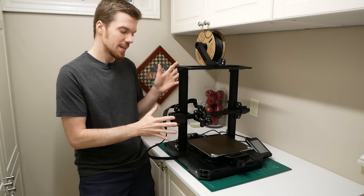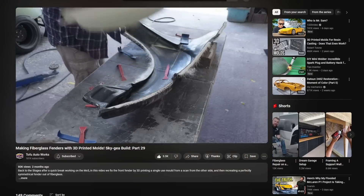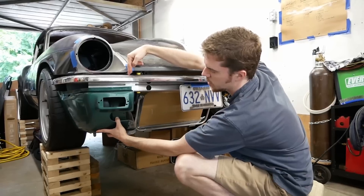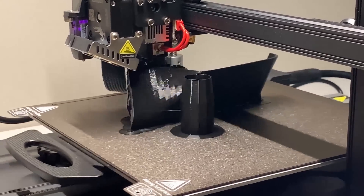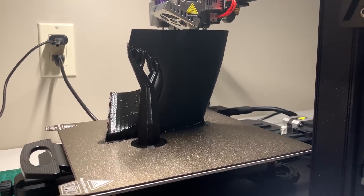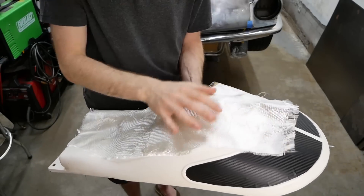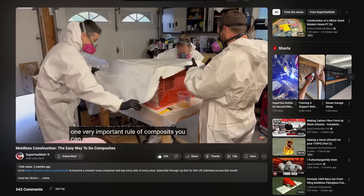To say it's going to make the molds directly is inaccurate. You can do that, and it seems to work well, but unfortunately if we hold a mold up to our car, we'll still have no way of knowing what the final part looks like, as it'll be the inside face that's the finished surface, not the outside. I'd like to see the bumper in person before even touching any fiberglass. What we're going to do instead is print parts that look like the finished product, and when we're happy, we'll simply skin over the face of them to make our fiberglass parts. That does mean they'll end up being slightly oversized and will require a bit of finishing, but as Superfast Matt says, you can never not sand. Let's not get ahead of ourselves, though — it's dangerous.